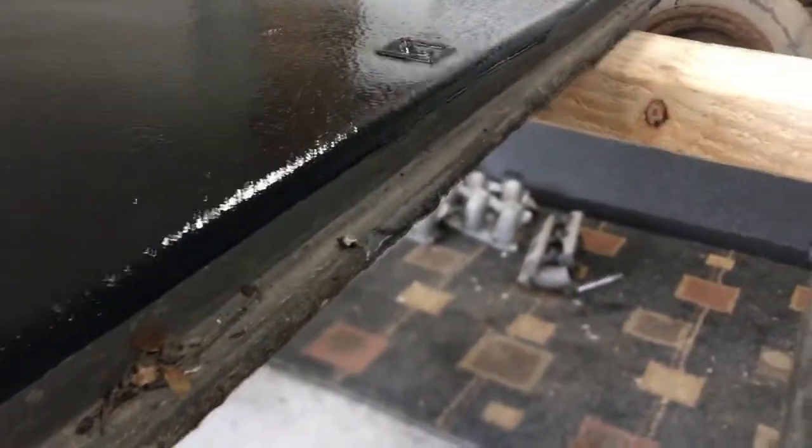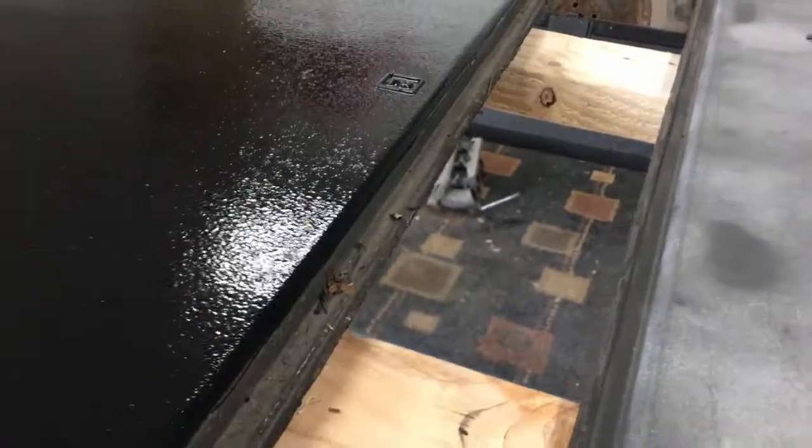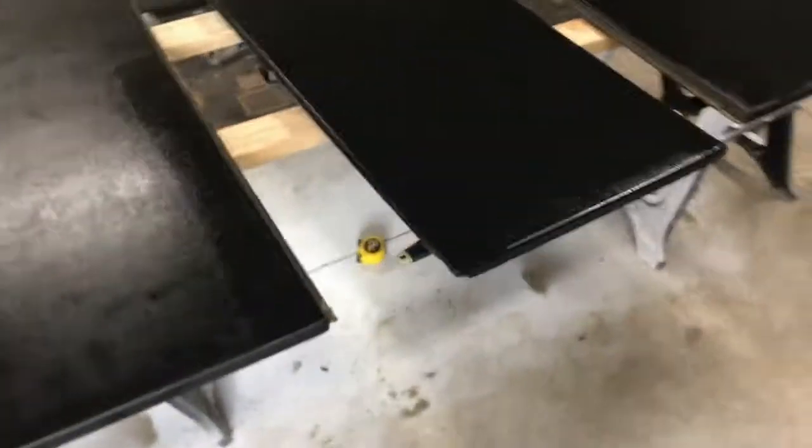Clean this out down here where the seal used to sit. I didn't think it was a big deal because, you know, I was only painting the top. I did, however, get a little bit on my roller, and that kind of pissed me off. So just a heads up, it might be worth your time to clean that out at least a little bit, get most of the big stuff out of there. Recoat time is in 24 hours according to the can, and at this temperature and humidity, it'll probably take every bit of that.